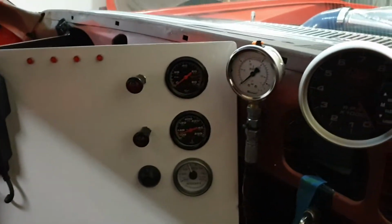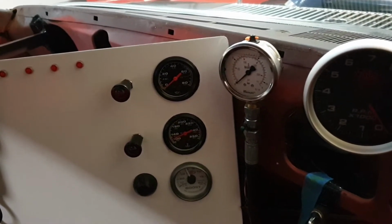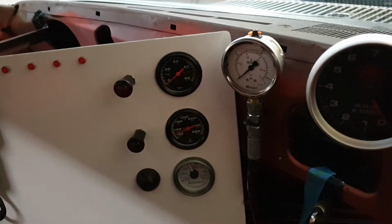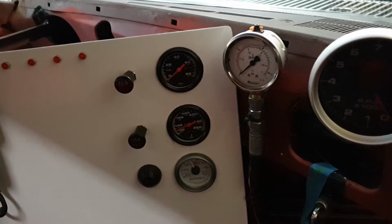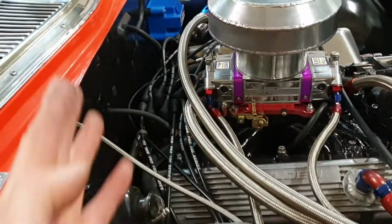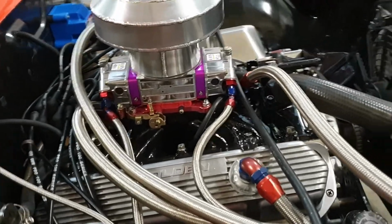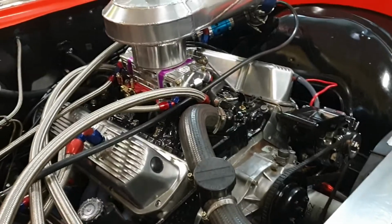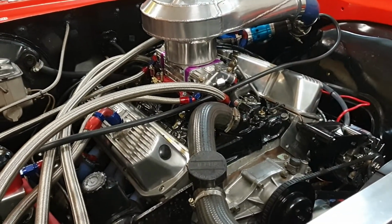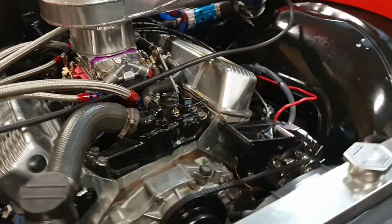Now they say once you get into drive, and that's my transmission pressure gauge there, the white back-faced one, they say no more than around 50 to 60 psi at any given time. And we get a touch over 50, then it drops back. So that's fantastic. They say anything over that creates excessive thrust, which just wipes out that crank. And that's what caused all the issue that I had when I first built this engine up. It destroyed the crank thrust. Very lucky I picked it up, actually. So good lesson learnt there. And look, it seems to be running like a dream at the minute. I'm very, very happy with it, guys.